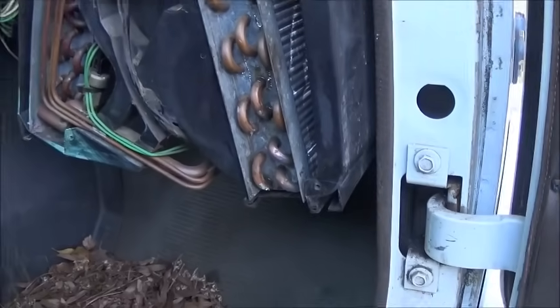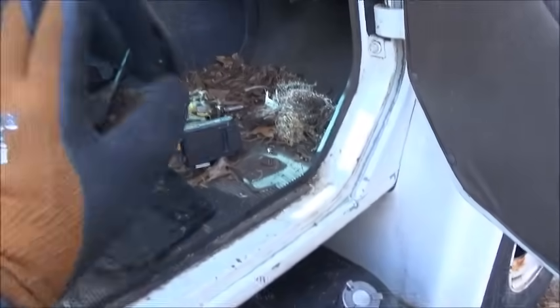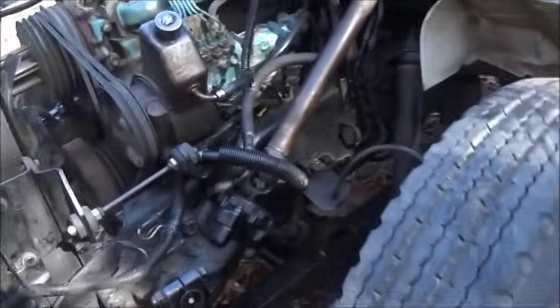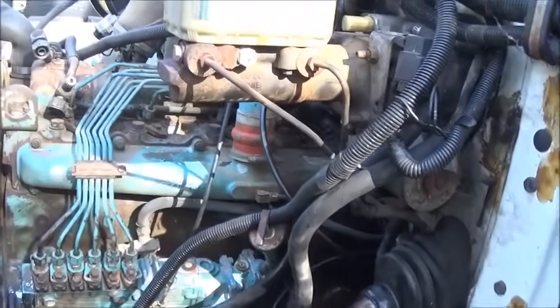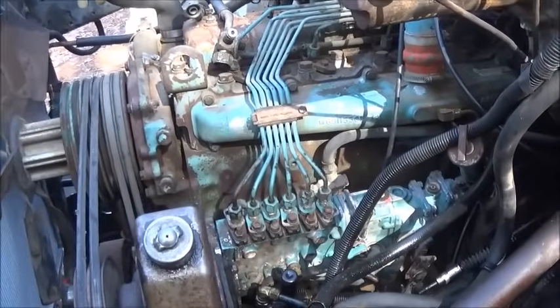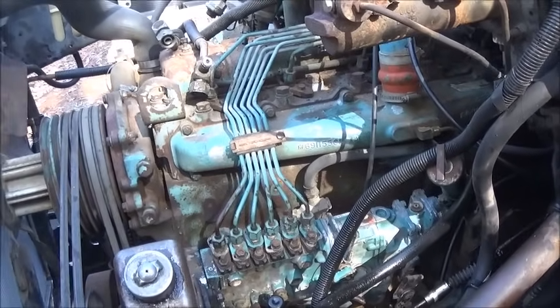Everything's soldered up and I've been running it. The temperature is up but not real warm — about 120-130 degrees. I still have to change the oil and do the oil filters, but I've got a new coolant filter on it, plenty of antifreeze, two new fuel filters, fuel lines done, and the throttle hooked up. There were some differences between the engines — I learned that the other engine is nothing like this one. It was an electronic engine with a manual pump on it, and they didn't build many of those — not nearly as many as these.